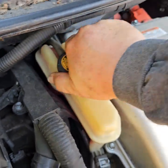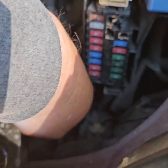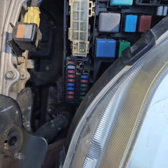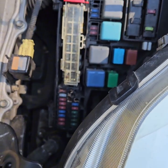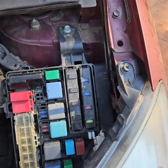This one is not the one that had the problem. The one that had the problem is in Tennessee — I can't get to it. You should be able to feel this and it should be humming, just vibrating. If that's vibrating, then your inverter pump is good. But this can still blow a fuse. It did on my daughter's car again — we replaced it and she's running again.